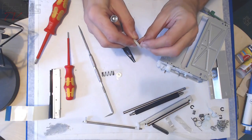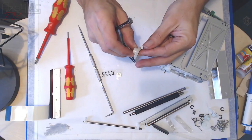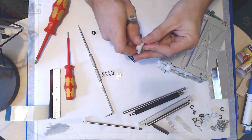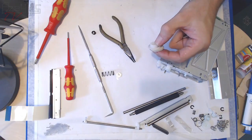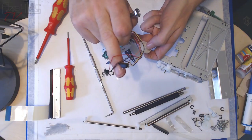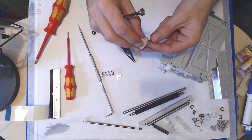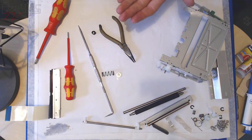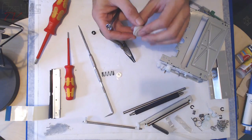If it gets to the end of the paper and tries to pull something through that isn't there, it might jam — so they've added this clutch so it doesn't jam everything up. Then there are the page-out detectors, like those infrared sensors, that tell the circuit board if the paper has run out so it can stop turning the motor. Clever idea — stops wear on the motor. There are actually two clutches, so it's like a double action.